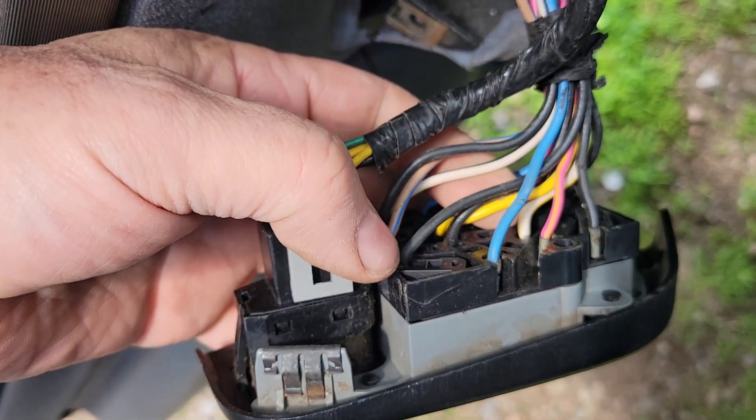I'm going to remove it. I need to make sure I get the right one because when I ordered from Dorman it was the wrong motor — a different size. I can't use this one because the gears are messed up. Definitively now — I had the clue all along. When I grounded that side and touched the blue/black it arced. I thought I had a power-to-ground short. That's why I was convinced I'd done something on that side — either way, good news: she's diagnosed.